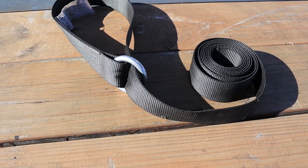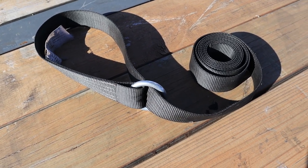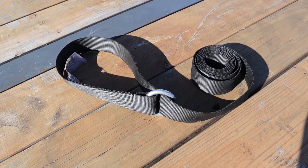You can use lasso straps, especially if you're hauling on your flatbed to fill in with cars when you can't find freight. Lassos use a two-inch ratchet strap that hooks onto your rub rail or underneath the side of your trailer. The three-point straps come in a few hook configurations: a wire hook, a swivel J hook, or — for enclosed trailers — an E-track hook to lock into the floor. You can also use wire hooks on D-rings.